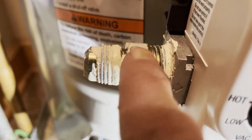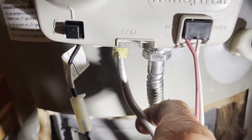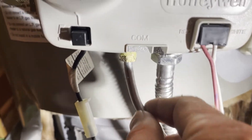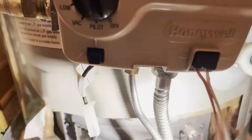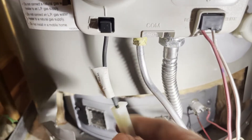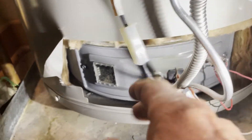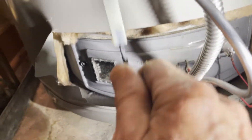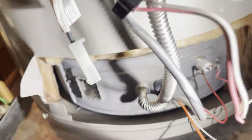We're going to disconnect the pilot assembly supply, the gas supply, and this wire harness, as well as this striker for your ignition — it's just plug and play, just unplug it and lay it aside. Down here is also a plug and play — it pulls out. That's the striker that goes to your pilot assembly. Those are the three connections that need to come off.